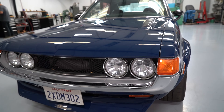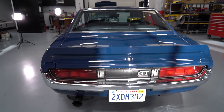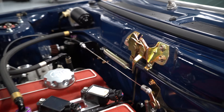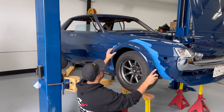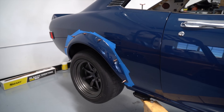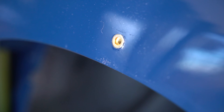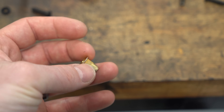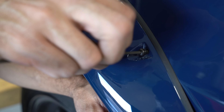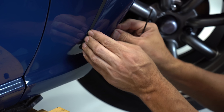The rest of the light lenses, including the taillights, were all buffed by Damien and then he clear coated them, which made them look brand new. Pretty much all the hardware was either new or we sent a lot of stuff out to get re-zinc plated, which has that factory gold look. After aligning the new over-fenders, they're drilled and then held in place with aircraft Cleco temporary fasteners. The final installation was done with nutserts, which are basically rivets but they have threads inside of them. We used stainless steel screws that are black and black nylon washers. The little weather strip between the over-fender and the paint is actually a Toyota product from a Toyota Tundra that has factory over-fenders.